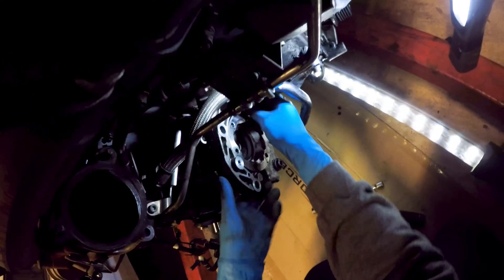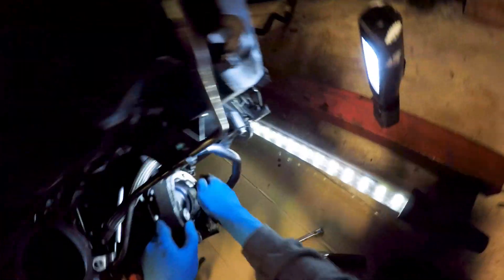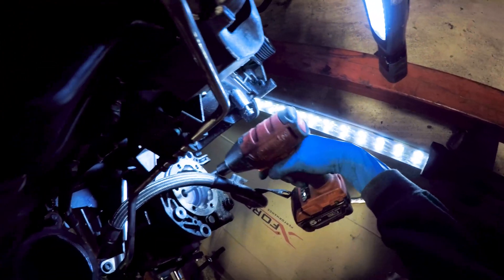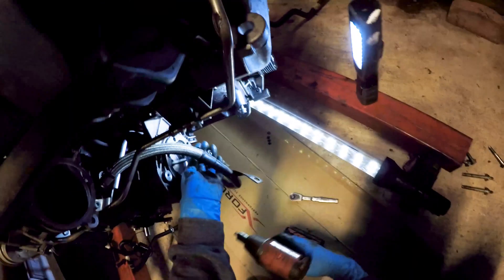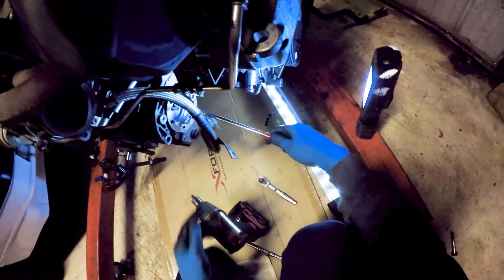I found that I have the weirdest little bevel box bracket here. They're usually a black bracket which slips out easily with the bevel box in place, so I wasn't expecting this one to be non-removable with the bevel box still in situ. The easiest way to remove the hidden bolt is with a rattle gun — there's no need to try and keep the gears from spinning. After this is the fun part, which is removing the four bolts that hold the bevel box onto the gearbox.